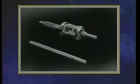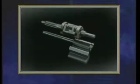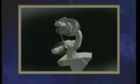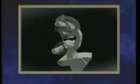The mechanism is made up of 2 flyweights that are spring-loaded toward the center of the shaft. The shaft rotates whenever there is a differential speed between the wheels. When the differential speed reaches 100 RPM, there is enough centrifugal force on the flyweight to overcome the centering spring. The flyweights move outward to engage the pawl of the lockout mechanism. One flyweight engages the pawl in one direction of rotation, the other flyweight engages in the opposite direction.